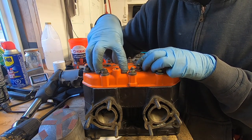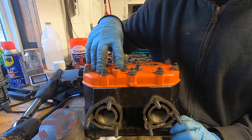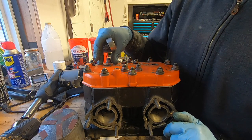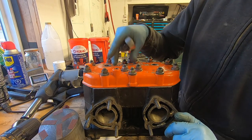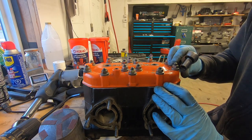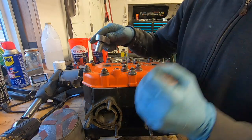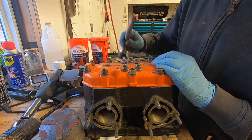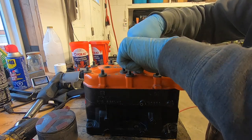Basically, the copper has squished enough by torquing it to 22 foot-pounds that I should be getting not only a good seal around the copper, but I should be able to seal around the water jackets as well. Now I'm going to remove the head and take a look at the copper o-rings and verify that they have actually seated and squished and that it's not just flex in the head. The gap should not return to 34 thousandths when I loosen it — if it does, it means all of the clearance I took up was flex and not crush of the o-ring. Good news — I don't see a huge gap between the cylinder and the head, so it wasn't all just spring.